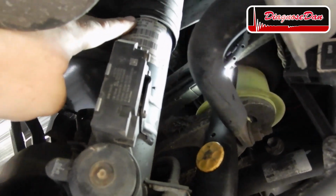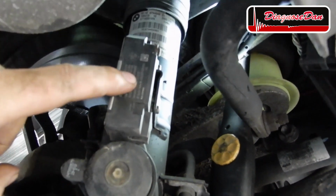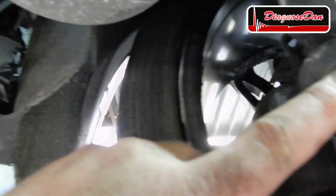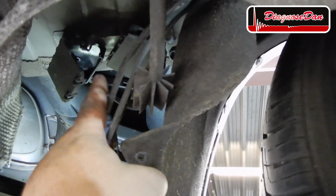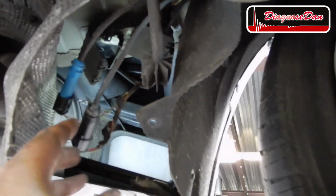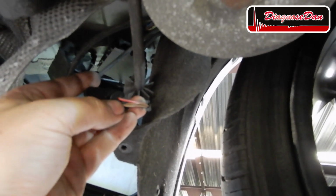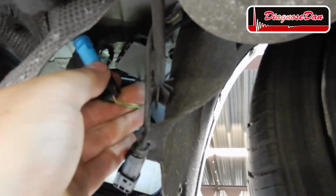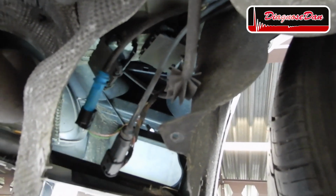Now, this is our rear left damper, and this is our damper control unit or satellite, which we can't communicate with. This is the damper control valve, and in between the mud guard and the heat shield over here, there's a holder holding the connectors of our damper. Now, the first thing we're gonna do is check the power and ground with a test light on pins 1 and 2. And if that's okay, we're gonna check the FlexRay communication on this green and pink wire using a scope.